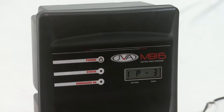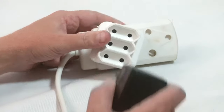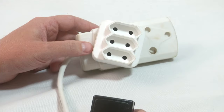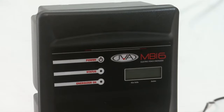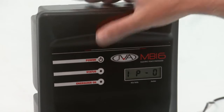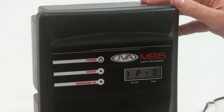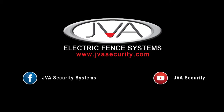If you need to default the unit, you would need to depower it. Once you've powered the unit back up, four lines will display on the unit — that's when you need to hold your power button in, then release it, and your unit will return back to IP1, which is the unit waiting to be set up to your Wi-Fi network.